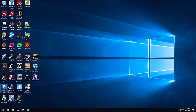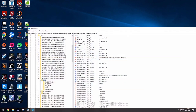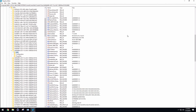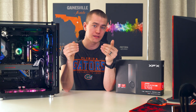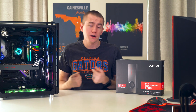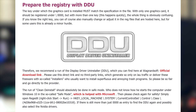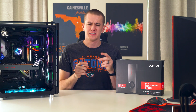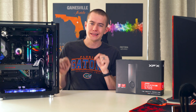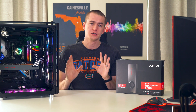In order to get your computer ready for this, you have to prepare your system first. It does this by registry modification, so you have to make sure your registry is actually set up. If you go to this specific line in the registry and click on it, if there's a folder that says 0000 and that's it, then you should be good to go. But if it has anything more than that, such as 0001 or in my case up to seven, then you actually need to uninstall drivers — which you should probably do anyways, just as a precaution. You can install DDU which helps you to uninstall your drivers. You should boot into safe mode and uninstall the drivers. I had to do it a couple times because the first time it didn't remove all of the AMD graphics cards, so I had to do AMD, then NVIDIA, then AMD again to finally get down to the quadruple zero only folder. Make sure that's set up and then you can install the drivers for your Navi card.